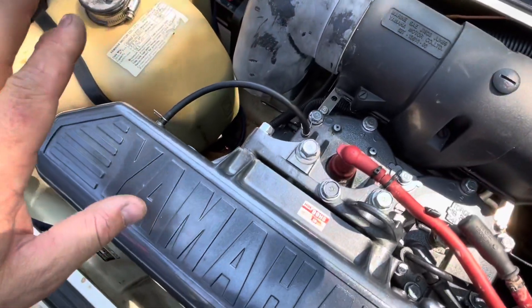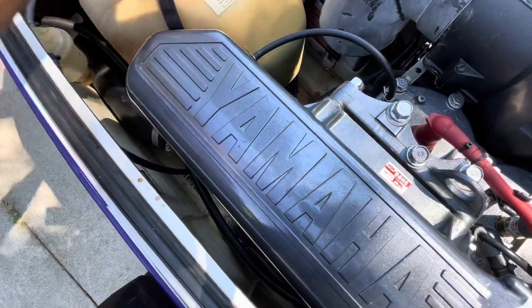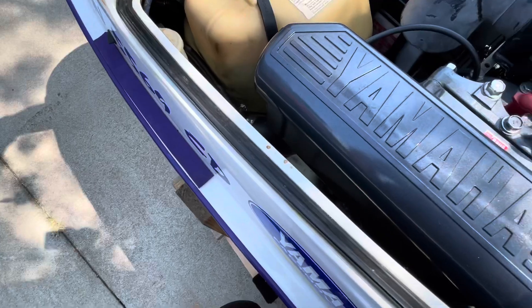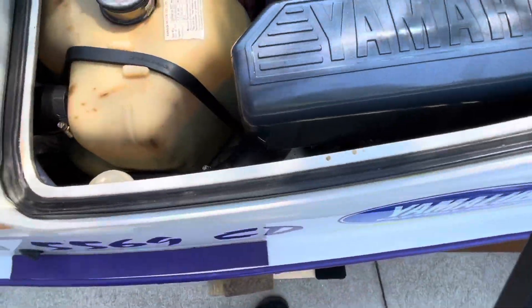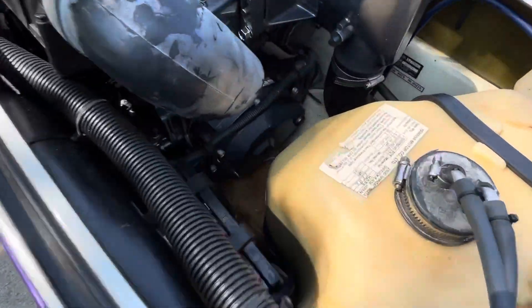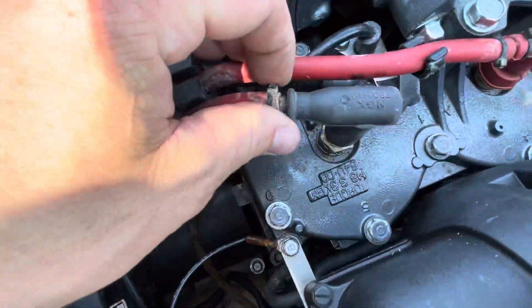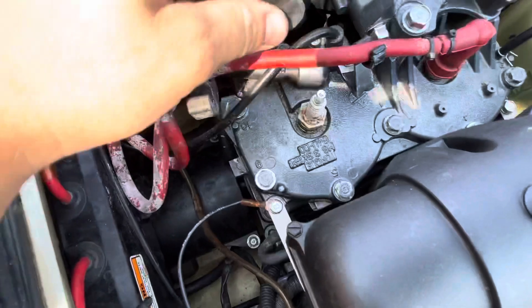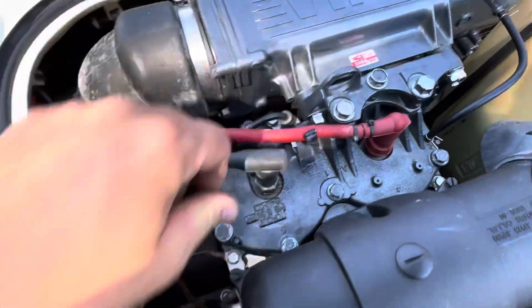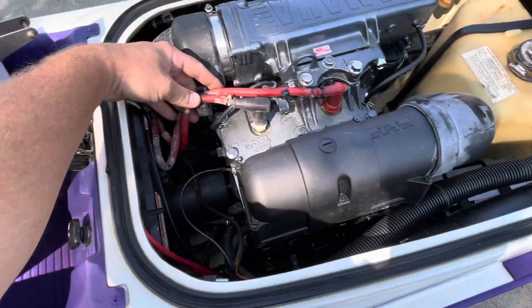Full tank of fuel, but can't really trust it — I think I'm going to drain it and just start off new, put some fresh gas in there, even though it does run. Super nice, super clean — just the fact it runs. You can tell that this spark plug is a bit rusty over here. I guess when it was sitting there was some condensation in here and just kind of rusted it. These spark plugs are really old, and when I went to test it at the lake, when I pulled the spark plugs it had a lot of carbon buildup.